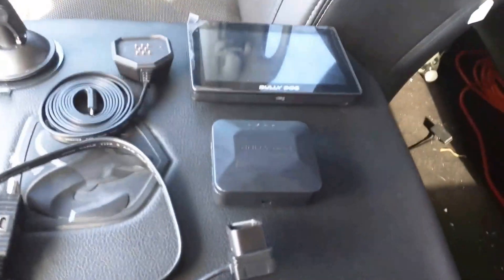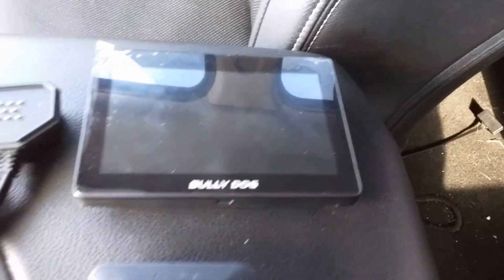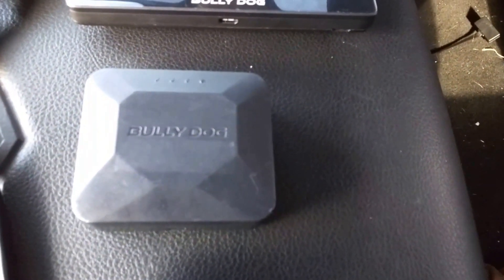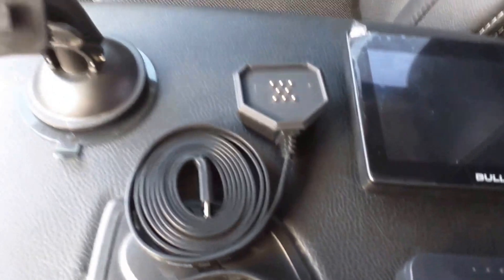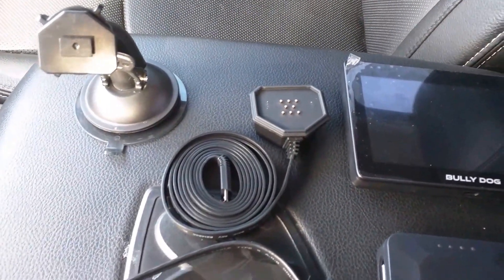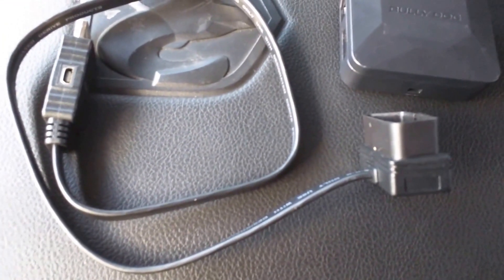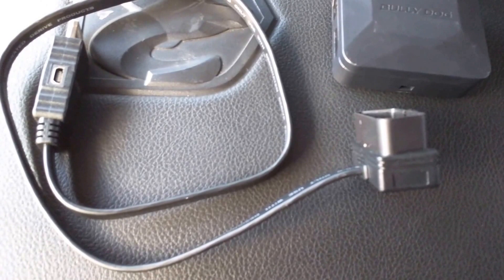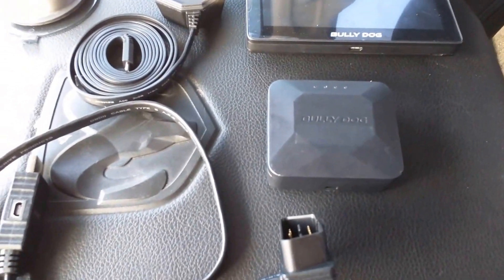Here's what you're going to get. First off, let's start with the monitor itself — you get a 5-inch touchscreen display. You get your vehicle information module, or VIM for short. You have your OBD2 cable, and you can see where you would plug in the unlock cable for the Cummins for the unlock process. You have your data transfer cable that connects to the back of the device, and then you have your window mount. Notice that we have gone to a flat-style ribbon cable instead of a fat HDMI cable. This allows the product to be hidden and tucked into the dash much easier, and the cables are not allowed to twist, which also gives you a more reliable connection.